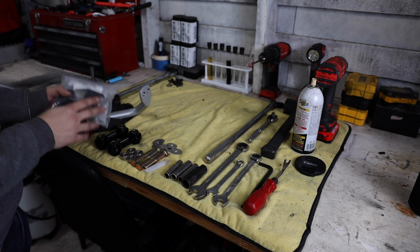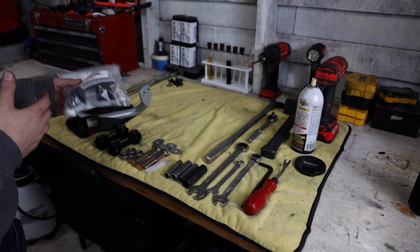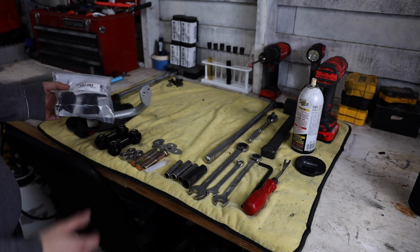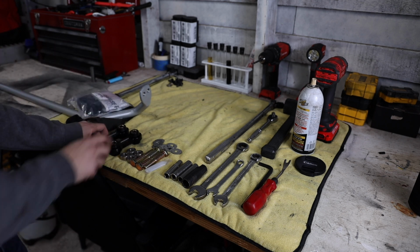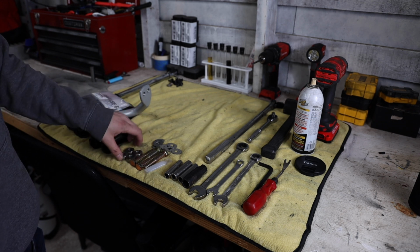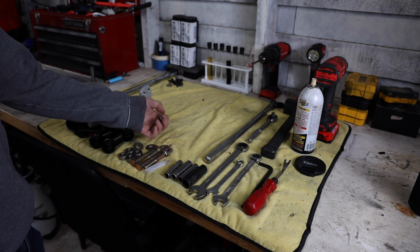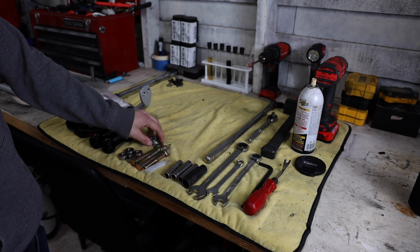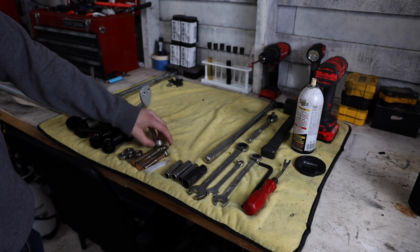Now, it also comes with these nice greaseless bushings, which are actually kind of fancy. They're a little fuzzy on the inside, so you don't need grease. But the Endlinks, so we have two of the front Perrin Endlinks that come with 4 washers, which are these spacers, and then a plethora of these 7/16 washers, which you'll see why we need all of these soon, but it's to help get the Endlinks perpendicular to the ground.